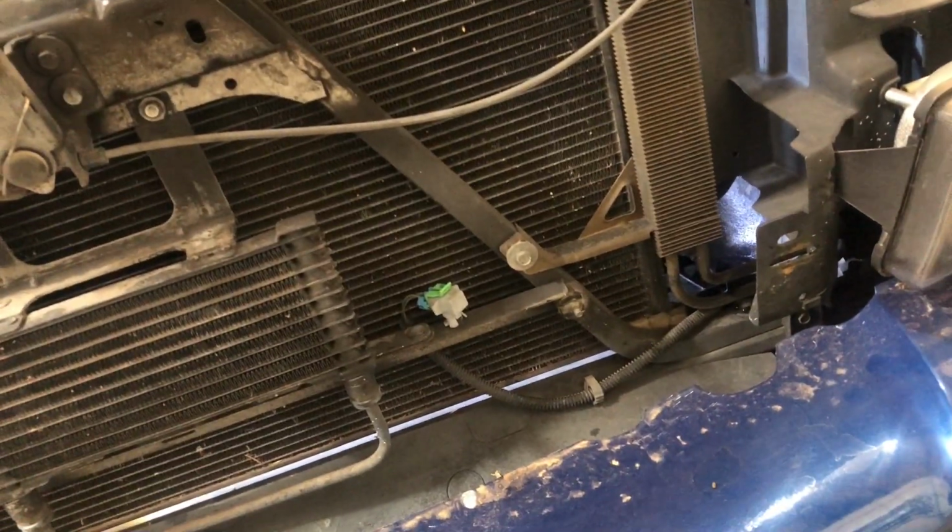It's just right there. Two of them. Take that off with the bolts and unbolt for the headlights. And after that, it should just come off, and just unbolt this so I can move this around, and that way it's out of the way. And I should be able to get in there after that.